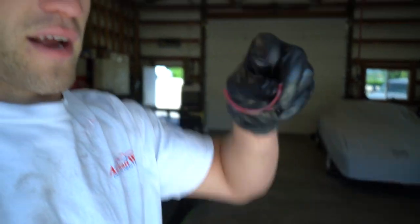So thankfully we didn't get too far along on this motor. Since the last build video you saw with this motor, I haven't touched it. In that upload, I got flooded with comments and messages letting me know that I should have only put the assembly lube on the side of the bearing that's actually making contact with a turning part. So only on this side of the bearing right here and not that side. And to be completely honest, I have no clue why I did that.